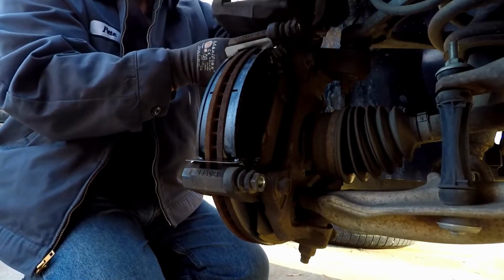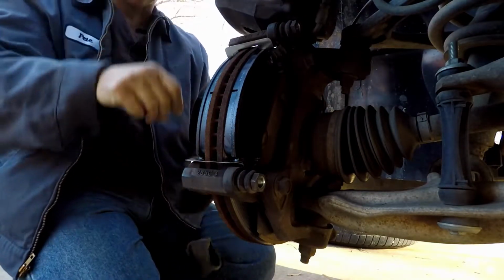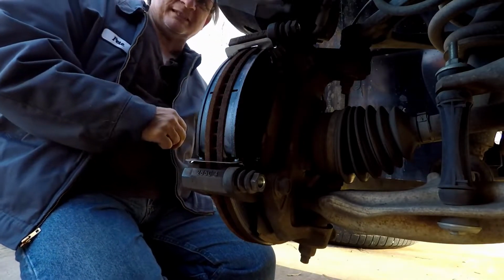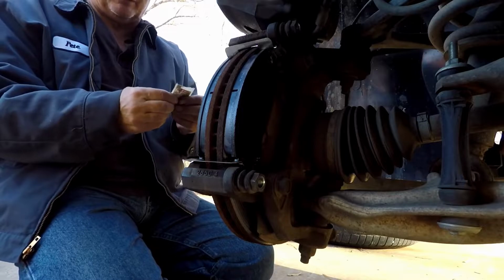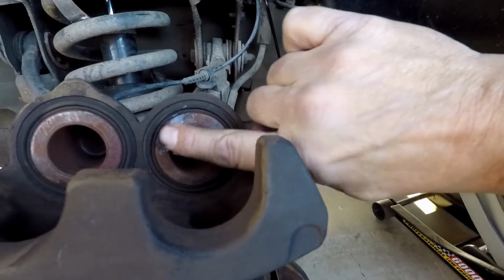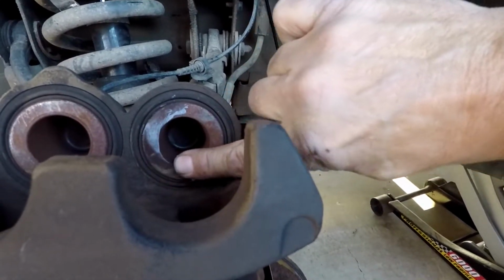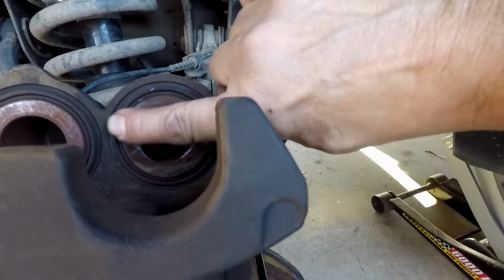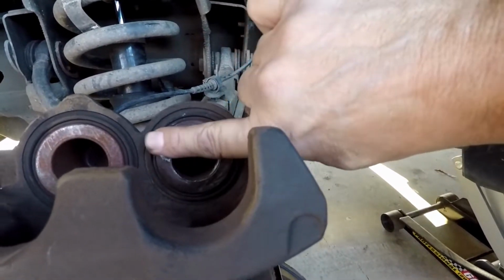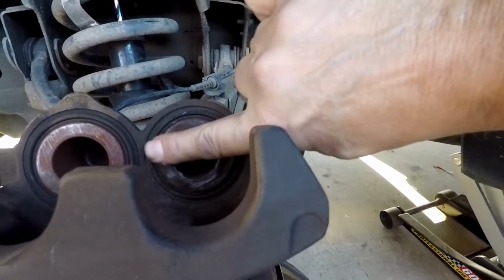hanger, and now what I want to do is put a little bit of grease on the rim of the pistons, and I'll show you when I get it on my finger. See how rusty this is a little bit, but this is another point of contact like I was telling you. So you want to take some, put it on your finger, and just run around that, and that will help keep the squeaks from ever coming.